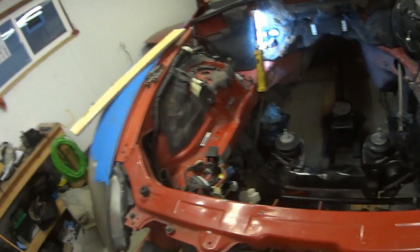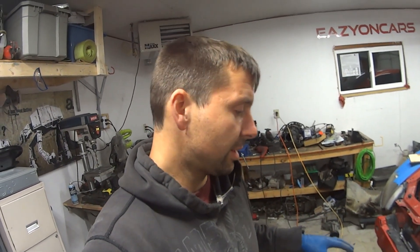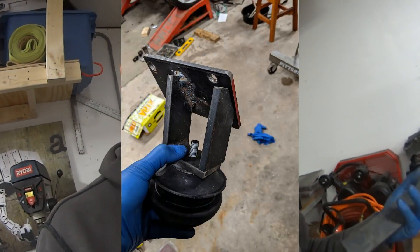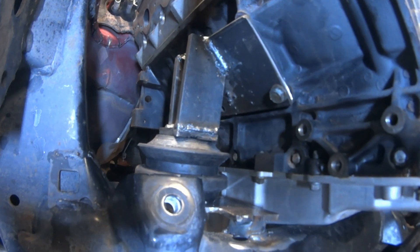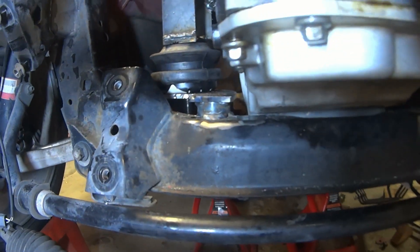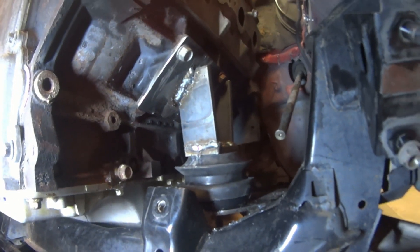The motor mounts are in place. The next step is to put the engine back in and make the brackets that bolt directly onto those. I'll probably clean up first — there are metal shavings literally everywhere. So I've been making the motor mounts today, and basically what I did is take this 2-inch, 3/8-inch steel and made some mounts based on what I was showing you. You can see there's the plate on the side, there's that 3/8-inch steel coming down, and I have a hole going right through the plates I installed. I just took out the shims I had under there, so it's actually resting on the motor mount now — one on each side. Pretty happy with how they turned out, probably about a day or two of work.